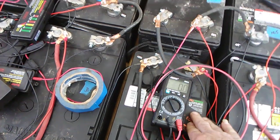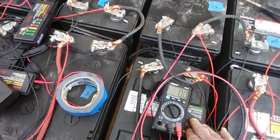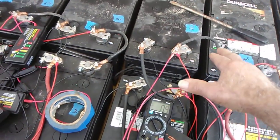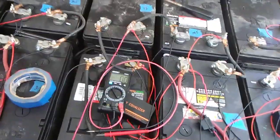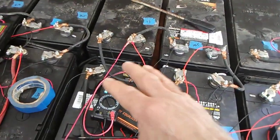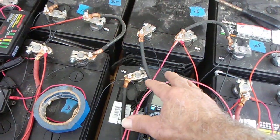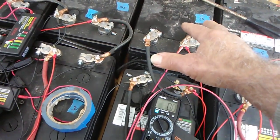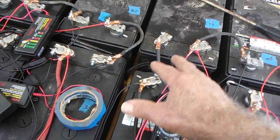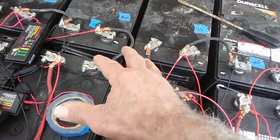So I pulled terminals off the battery and measured the voltage, and I found one of the batteries was way, way lower than the rest of them. What you're going to find is if you take a voltmeter across a set of batteries where there's one bad battery in it, you're going to have cells reading like 15, 16 volts. Normally, if they were well-balanced, your average voltage would be about 14.5 volts on each battery.